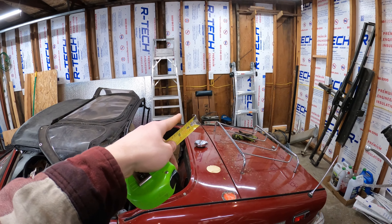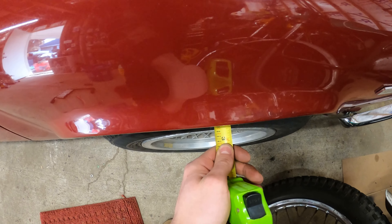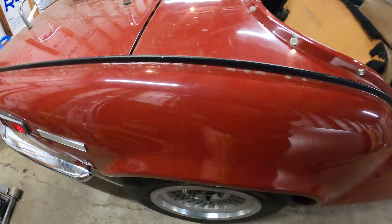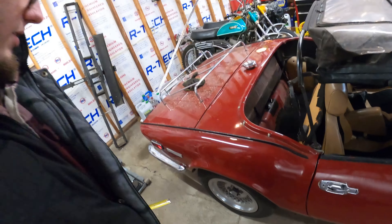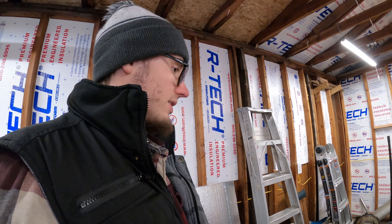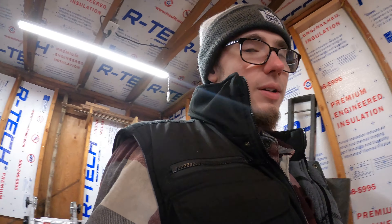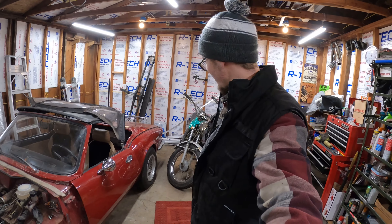That side of the car is close to an inch lower. Measuring from the first tire tread to the fender, I get about two and a half inches on one side and three and a half inches on the other — something is drastically wrong, and I think it has to do with the leaf spring being super old. So I'm going to put some research into that and maybe order a new leaf spring. That's how it's going to sit for now until I can start working on the front end. It's back on the ground and it moves — the rear is lowered, at least. If you liked the video, please like, comment, and subscribe. See you in the next one!